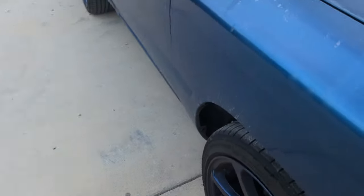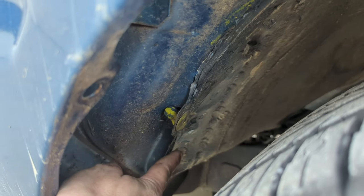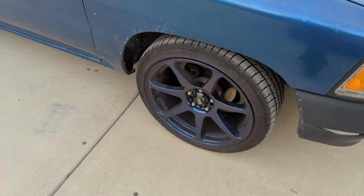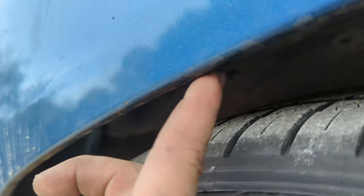Same thing on this side — I hammered everything flat. Here's part of that pinch weld you might be able to see up there. There was a nut where a bolt was sticking out on each side — I chopped the bolts flat so they weren't poking out of the welded nut, then hammered this area back the same as the other side. And like I said, it doesn't hit at all except right here — just a little bit over certain bumps it rubs right there.